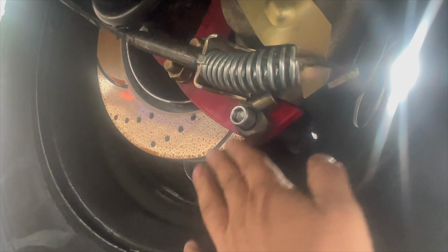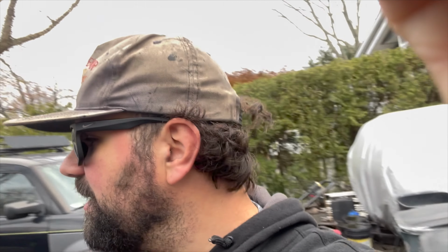Did you guys see the truck's been sitting for a little bit? So you've got the rust building up, but these things are great. We absolutely had zero hookups, zero issues with the kit on the test drive and then driving it around because, with the dually and the spacers, you want to ride around for 20, 50, 100 miles, whatever it is. Then you want to check to retorque everything as far as the wheels, and then you are good to go. So that's exactly what I'm doing.